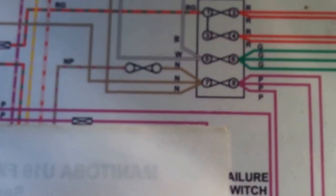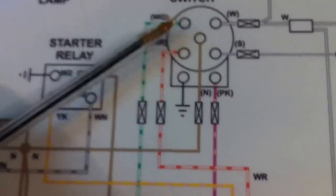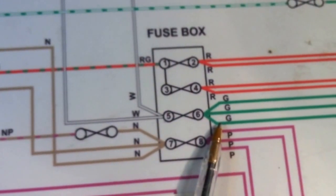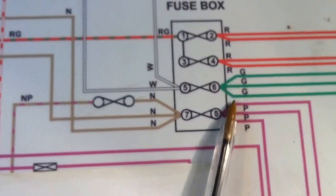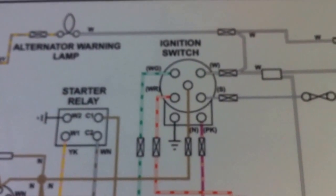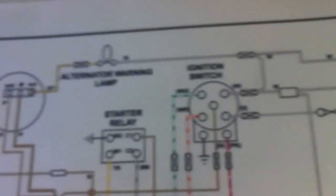And I kind of misled you a little bit earlier as to what the objective here is. While the wires here are providing 12 volts from the ignition switch, I guess I've got to move the camera before I start pointing at stuff. So by putting a relay in this circuit, the ignition switch is still going to pull that relay in, but all of this circuit here is going to be fed through the plus 12 volts of the contacts for the relay, which can pass up to 30 amps. So all the current that is going to be fed on these circuits is no longer going to go through the ignition switch, but rather through the relay. So the current draw on that ignition switch is going to drop dramatically, and hopefully that'll save the switch from heat and all the other good stuff that comes with high current flow.